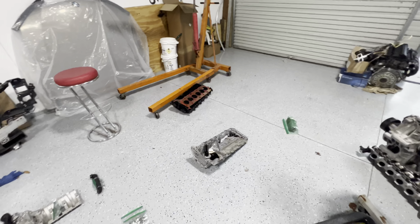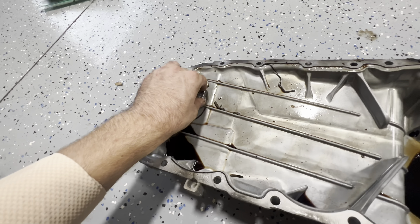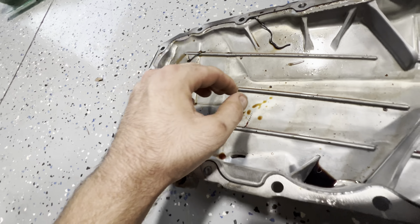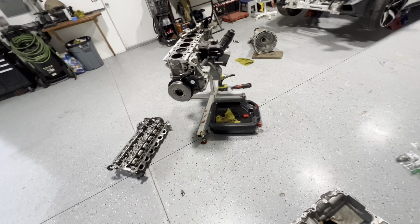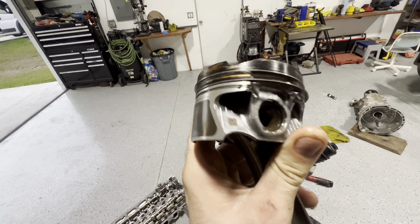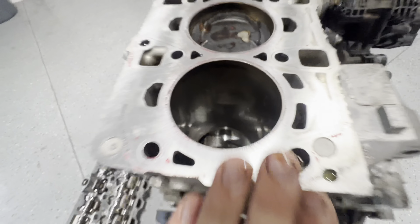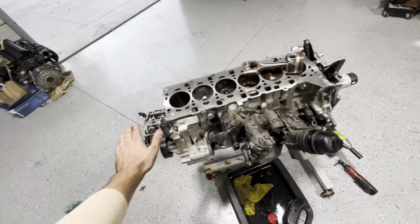Now let's get over to the motor. The first thing I did was pop the oil pan off and I noticed some piston material — some piston rings and an oil scraper off the piston. Then I took the head off. After further inspection, when I looked down through the bottom of the block, I noticed that piston one blew out its rings — only piston one. The good news is the cylinder walls are still good. I'm pretty sure this block is still good — you could drop in a new piston and you'd be fine.